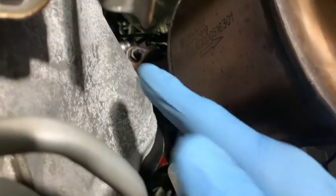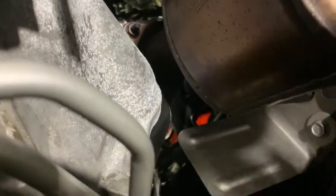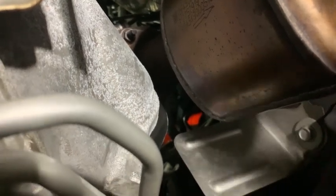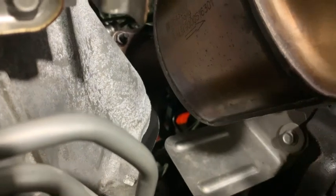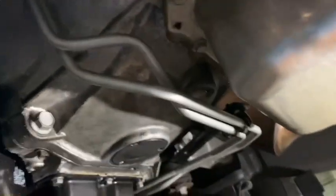from under here. But it's kind of aggravating to get to those bolts right there and loosen them. If they even loosen up, you know, they've just been sitting there hot on the exhaust usually, and it's cold. Usually if I'm gonna break loose exhaust bolts, I'm gonna do it while it's warm. When I first shut it off, break them loose and let them cool off before I finish taking them off. But it was already cold, so I didn't want to try that and end up breaking something off.